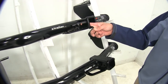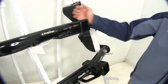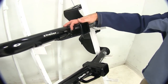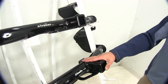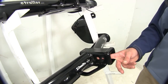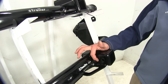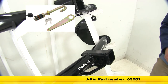Another very minor difference is going to be the pinholes. The CURT has a single 5/8 inch diameter pinhole — great for securing all of your items with plenty of room for just about whatever accessory you might choose to use. The same can be said for the DrawTite; we've got a good amount of room for whatever accessory, but we want to keep in mind we need to use the pinhole closest to the front of the vehicle. It's larger and 5/8 of an inch in diameter. The pinhole located a little further back is for use only with the J-PIN stabilization system.